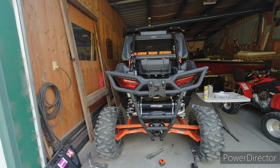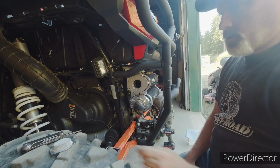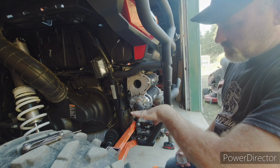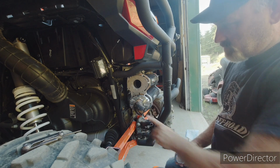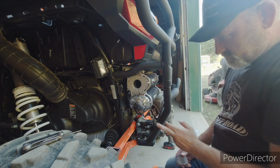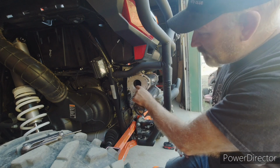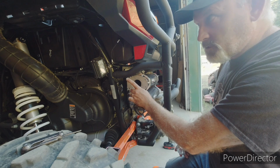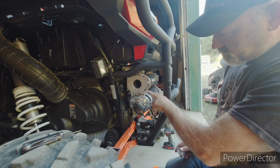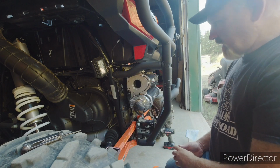Go find the right wrench. Unscrew those, put the spark arrestor in there. Okay, so you see I've already turned this one down. I'm just turning them down slightly so if water goes in there it'll run back out, because this here is flat. So water could go right in there and into that packing. When the packing gets bad, you're supposed to check this every 30 or 40 hours. I think it's 30. And then you can unscrew these and slide that out to redo your packing.